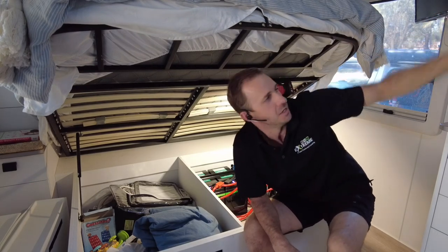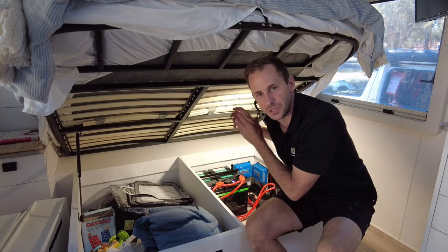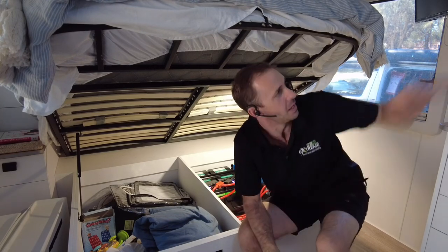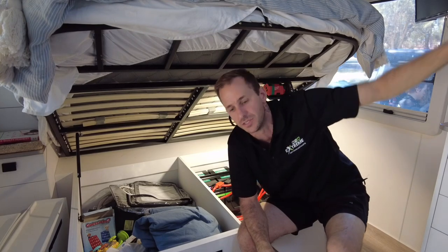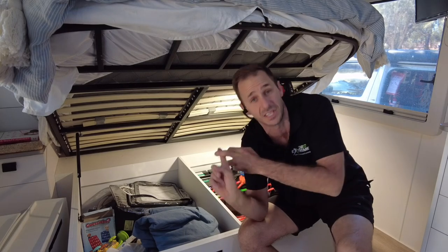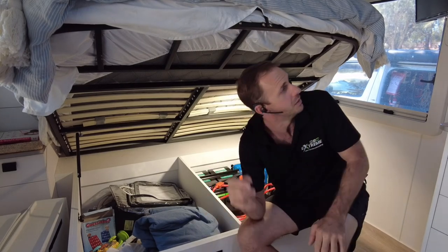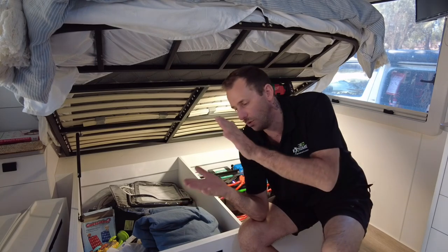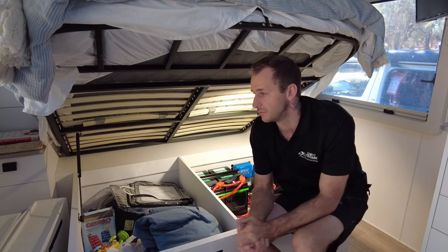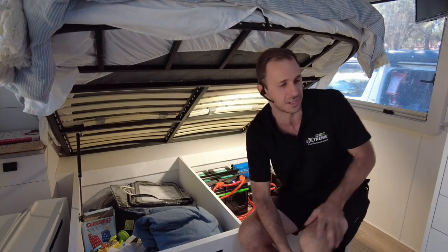It'd blow it up. So we reroute everything through a separate shunt, i.e. the Victron BMV 712, and that is gonna tell these guys time remaining, percentage of charge, it'll log a history of deepest discharge, time and cycles that it's taken to charge the battery, time since last full charge on the battery, and it's Bluetooth. It's all accessible on your smartphone or smart device. Very simple, effective. This is a really good off-grid setup, guys.